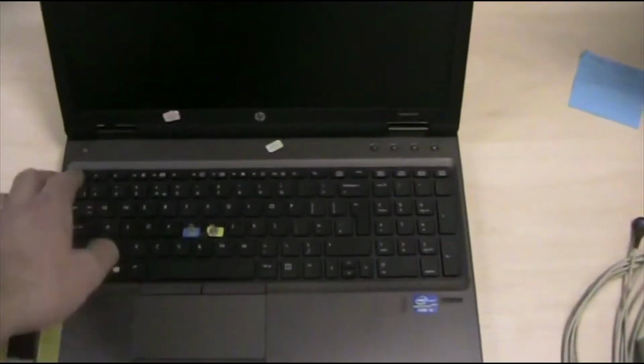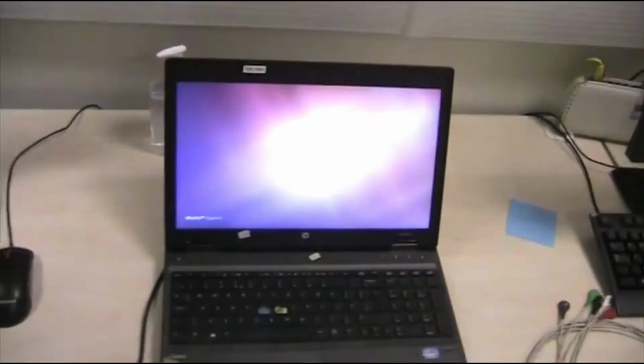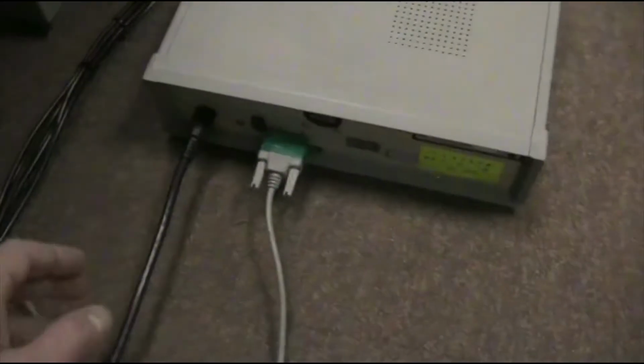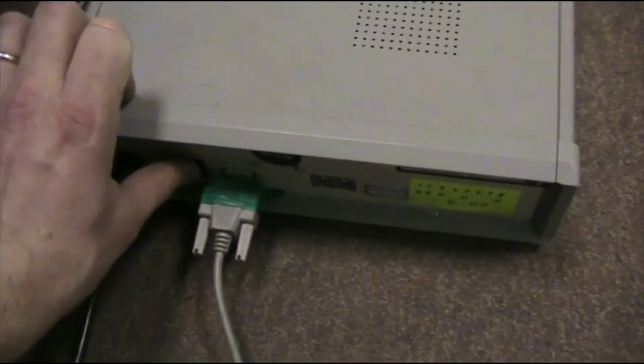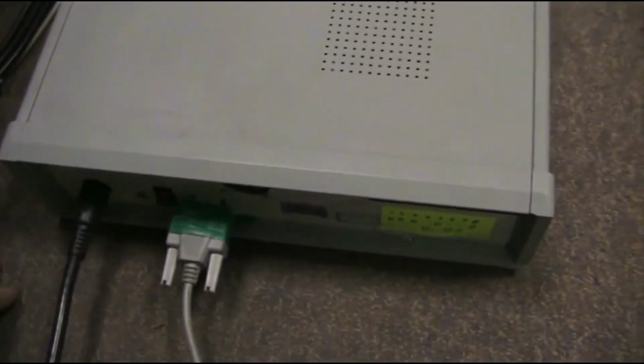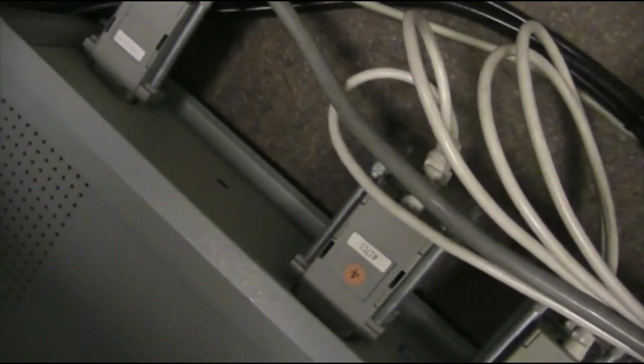When the laptop boots up, it gives an address to the adapter card, and that address will change if you unplug and re-plug the card, so don't touch it. If something doesn't work, turn it all off and turn it all on again. Turn on the switch at the front, there's some satisfying whirring noises, and then there's a light on the front panel that flashes, and when it stops flashing in about 5 seconds, it's ready.